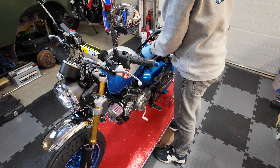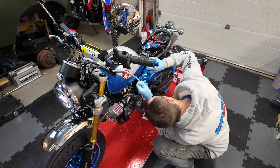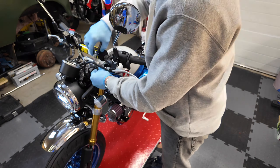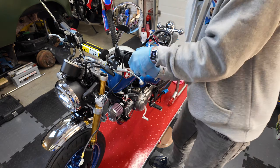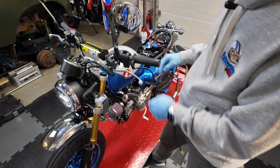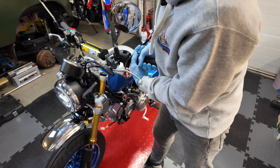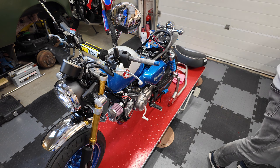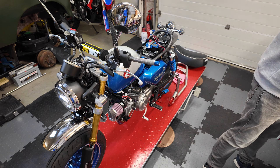Let's get the old wiring harness off the bike — they're not the same connectors as the newer versions so these need to be removed, then unclip the wiring to the grips. The instructions say you must use grip glue. I didn't glue the old ones on and they were really hard to remove — it could be the knurling on the Pro Taper bars. So make your own decision on grip glue; if your bars are smooth it's probably a good idea to use it.